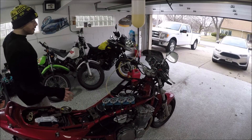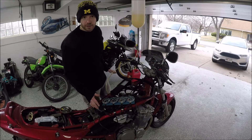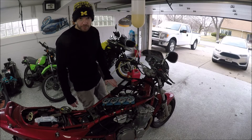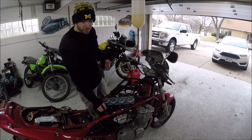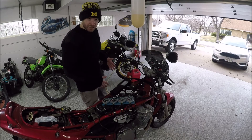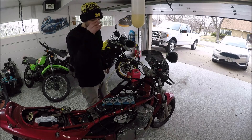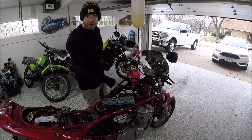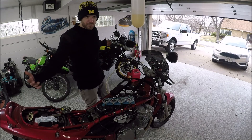So my final thoughts: I think you can get a pretty good tune with the cheap gauges, assuming they're working correctly and somewhat calibrated like I did. That being said, the Morgan Carb-Tune is much easier to use, much easier to read, and you don't have to fidget with the little restrictors. But a lot of the recommendations for the carb tune — people saying those cheap vacuum gauges are absolute garbage — I think a lot of that is elitist nonsense for people trying to justify their purchase. That said, I'm going to keep using this carb tune going forward. Thanks for watching.